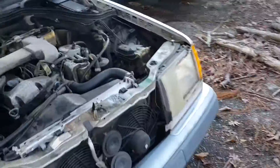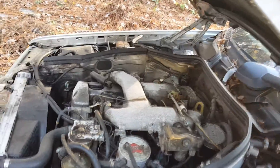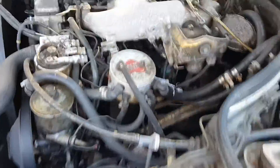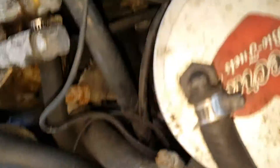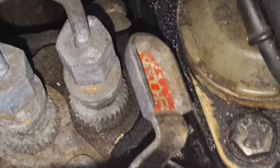So this is a pain in the butt. You can still hear me over this loud diesel engine. If you have a Mercedes-Benz and it won't shut off, what you do — this is on the older models — inside here there's actually a switch, a lever. You push this lever in, it shuts the engine off.